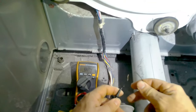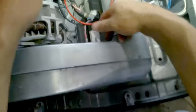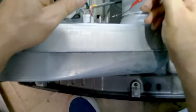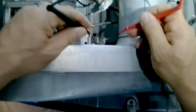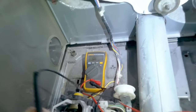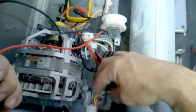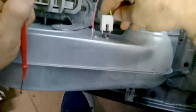We're reading in ohms, and continuity is basically 0.0 to 0.5. This is the motor thermostat. If this reads open line — this is a good one — but if it is open, this will cause the dryer not to start. If you press the start button the dryer will basically do nothing, just make a click, and that's the relay from the main control board.